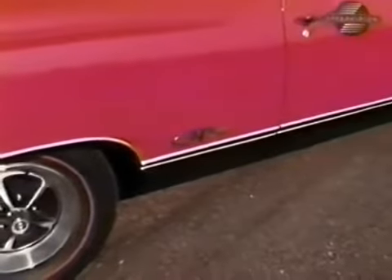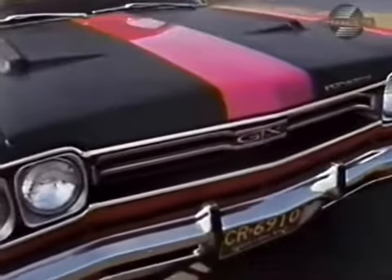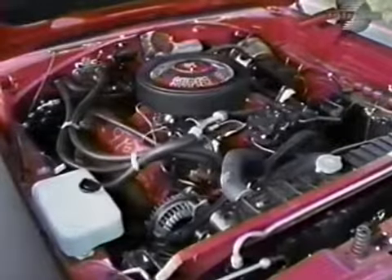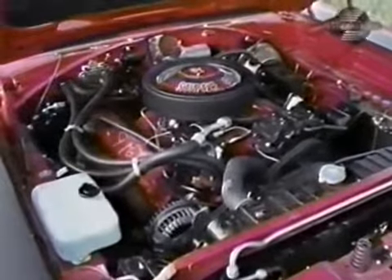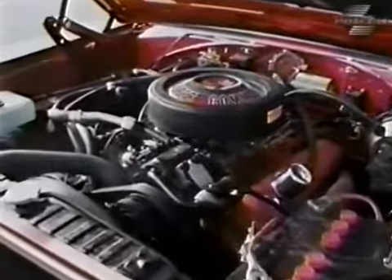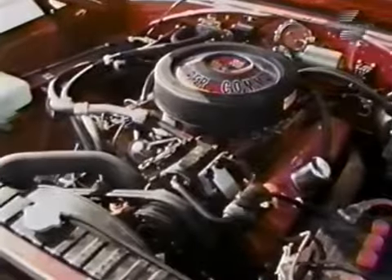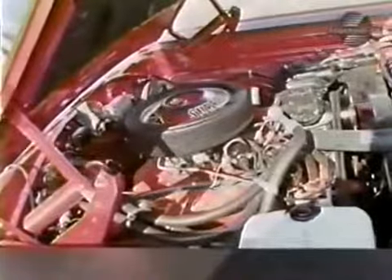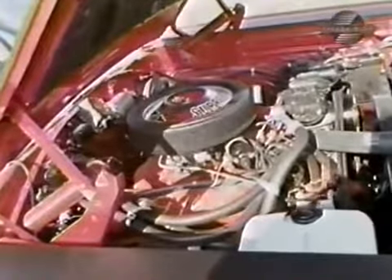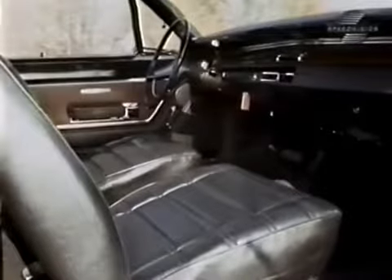The GTX signature is conspicuously displayed on the rear quarter panels. Our GTX had the cool air induction system called the Air Grabber. On the Roadrunner, it's called the Coyote Duster. It really works to increase engine efficiency and performance by pushing either outside or inside air into the engine. Trap doors designed to alter the flow of air are operated by a Bowden cable installed under the instrument panel. At high RPMs, this 440-incher breathes great big chunks of atmosphere through one Carter four-barrel carburetor and delivers 375 horsepower at 4,600 RPMs.